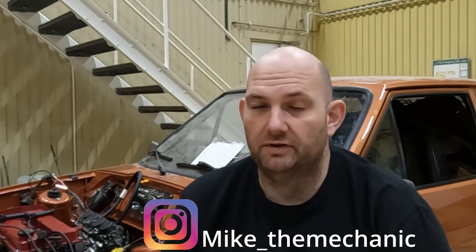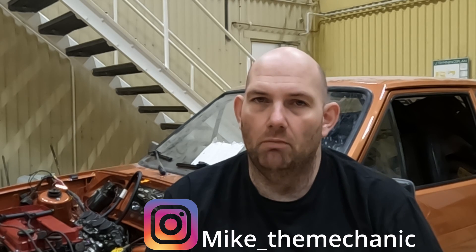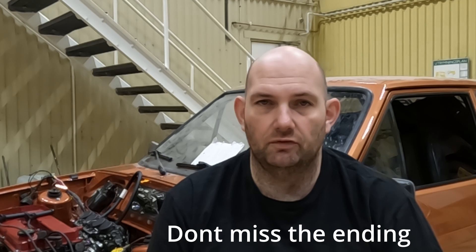You've probably seen a previous video where I did an unboxing of the Motorsport Gen X ECU. Today we're going to wire it into the car. The Gen X is a standalone ECU system, and it's for builds like this one where I've gone from the original distributor system to a more modern coil pack system. It's completely standalone, so I don't need the wiring from the original Mondeo where the engine came from. I'm also running the car on bike carbs, so I don't need any injection system.